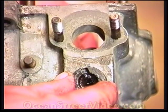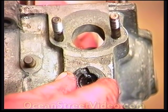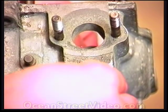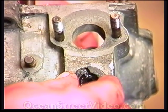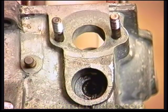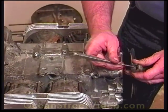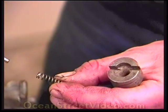What happens is because the timing gear — the brass gear we showed you earlier — is helical, the distributor driver will automatically rotate in as you drop it in. It'll rotate down like so. We want it in this position when it's seated, so we have to drop it in at this angle first. It goes in and rotates into the position it should be. We drop the distributor drive inside the engine. If you notice on top of the distributor drive there's a hole — a little spring goes there. It kind of acts as a buffer or shock absorber for the distributor.